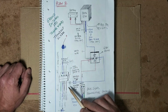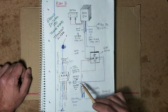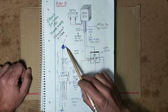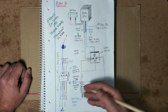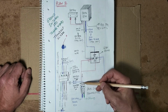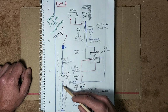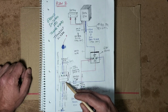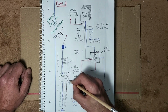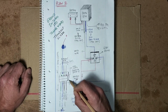doesn't work. The length of this cable here was short and the cable was very thick. I have swapped this cable for the thinner one. It doesn't work. So there's just one last thing to do. I don't know what's going on here on this side of the circuit. There must be, when I turn this off, some current still deviating the electrons towards that side. So the last thing to do is to place a diode here. So that's what I'm going to do now.